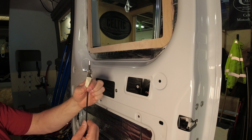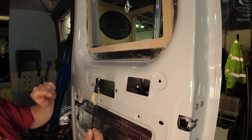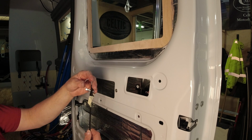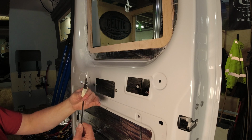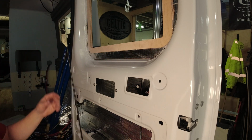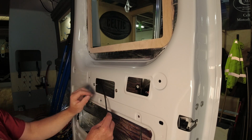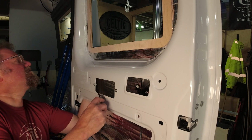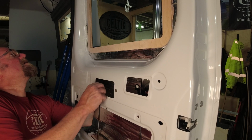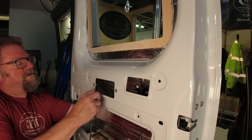You're going to get this end of the cable with the stiffening block in it. You need to push it up this side of the door frame. I've just taped that in place. Try not to kink that, but just tape that in place so that it's able to push up and this isn't going to get jammed. You've got bolts in there, so take any insulation out that you may have put in there. First thing to do is to feed that through there. Now you can just feed that up there, and then once it comes out the top, we know we're good.